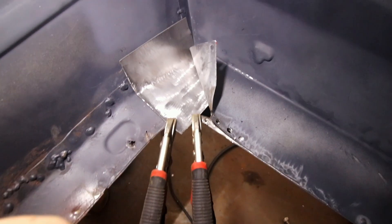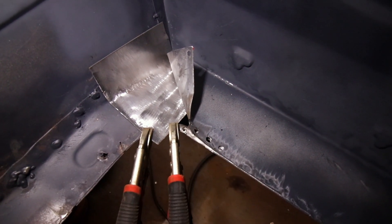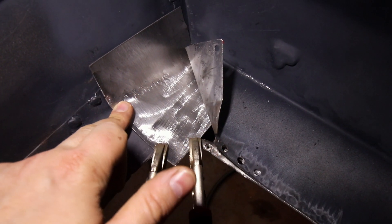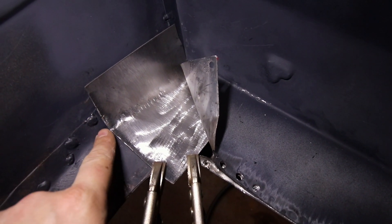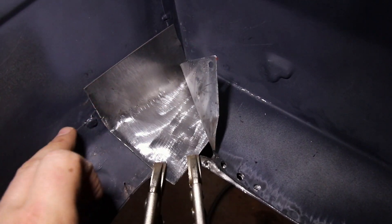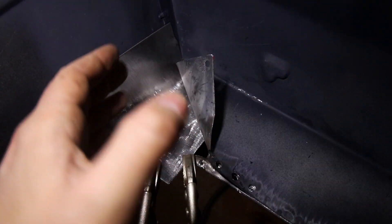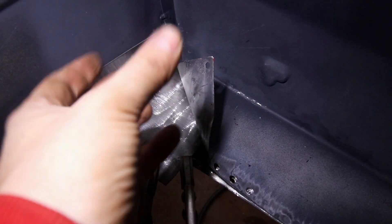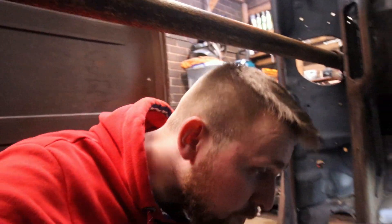I've made a bit of progress — I'll show you what I've done. I did have to drill a couple of spot welds out because when I did the doorstep I must have forgotten about this and spot-welded the whole thing up. So this is what I've come up with — that's where I've had to drill the spot welds out to get in there better so I could flop that back. I've basically slid it down the back, knocked it into shape. I'm going to draw a line down here, cut through that, cut this down so it follows the line, then once it's all prepped with weld-through primer on both sides, I'll flop it back and drive a self-tapping screw through to pull the two panels together. It was a tight space to get into — I had to whip the Dremel out and use a wire brush to clean all the metal off so I get good welds.